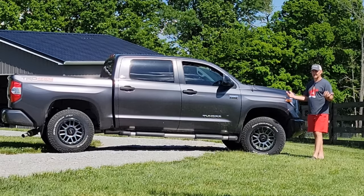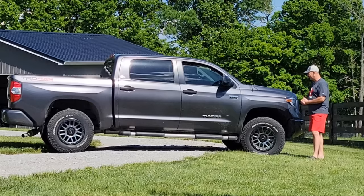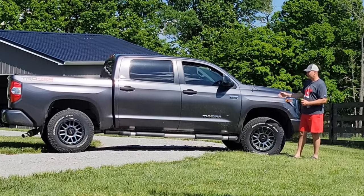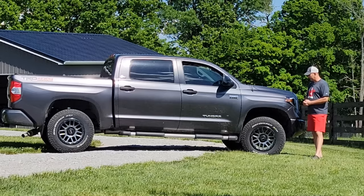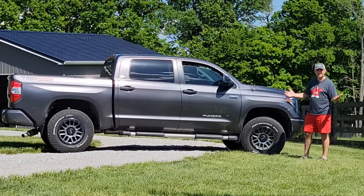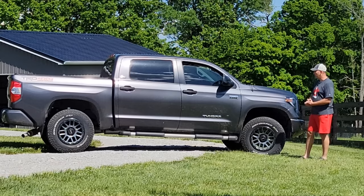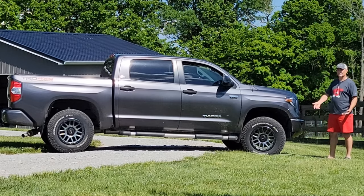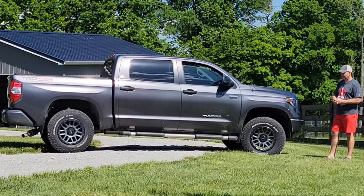The first three or four years you're usually pretty good, but once you get to this age in this climate, it'll just destroy a truck. When I bought this truck I looked up underneath, checked the cab corners, rocker panels, bottom of the doors, the bed, the frame, cross members, and suspension parts — and there's just not much if any rust in this truck. In wintertime I do wash my trucks on a fairly regular basis and try to keep the salt off.